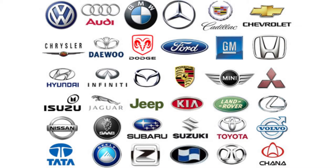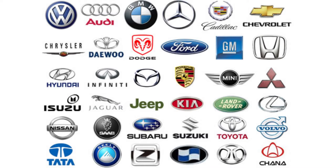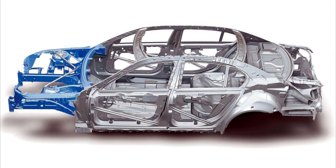This begs the question: is one generally better than the other? Well, maybe, but we have to be more specific. In this case, we're speaking about ground planes and, to a lesser degree, RFI issues. With that in mind, we can make a few general statements. As a rule, unibody vehicles exhibit fewer problems, both in ingress and egress RFI. This is due mainly to the all-welded body construction.